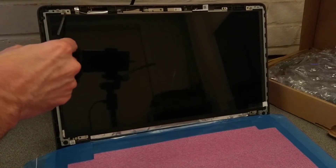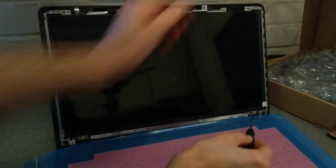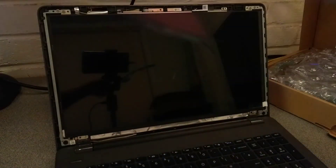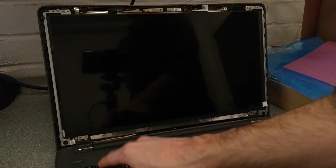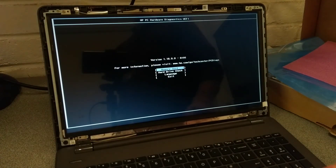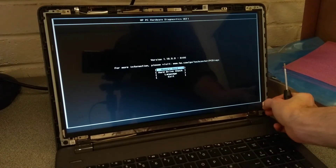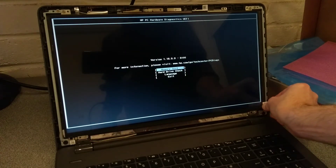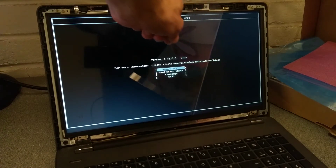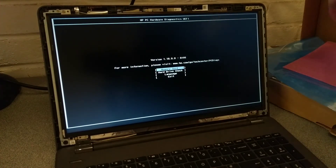Now the final one — so that's two screws up here, then the screen and the bracket, and the screen and the bracket over here. So I'm just about to do the final bracket one, and then at the bottom just the ones which hold the screen in there and there. Back in, and before I put the bezel on I'm going to make sure that the screen hasn't been smashed and still works. Looks pretty good to me. You can see this protective layer symbol, so that's going to be difficult to take off once the bezel's on, so we do need to take that off now.